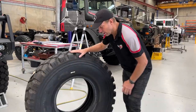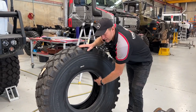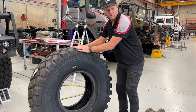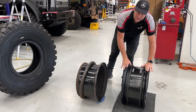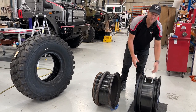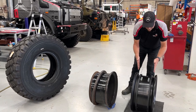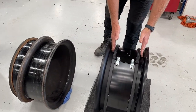For those of you who don't know, the bead of a tyre is this section here. Every single manufacturer has a different thickness bead. So when we've got a Michelin XZL, we can supply a beadlock rim and Hutchinson's to suit the XZL. There are also a few other brands we use that have a different size bead, so we can supply a different thickness beadlock. There's no point trying to jam a 30mm bead in here because it's going to have no traction on the beadlock at all.